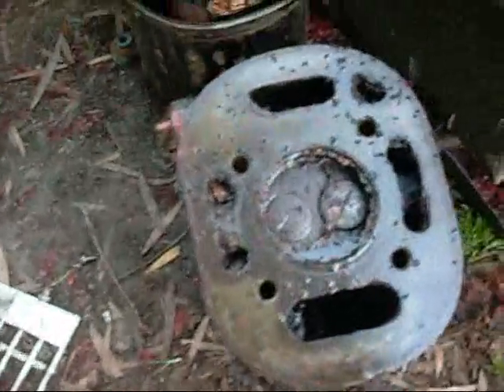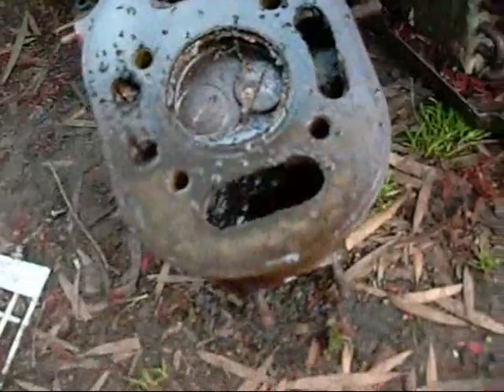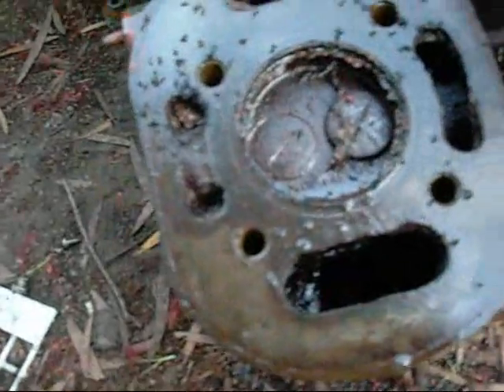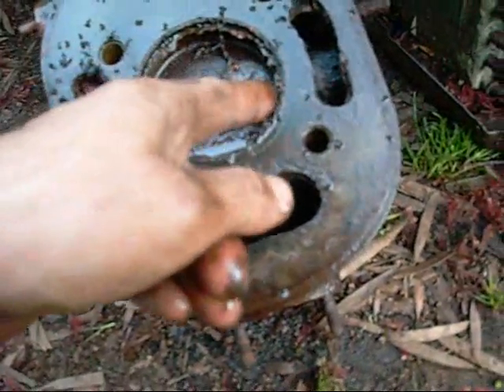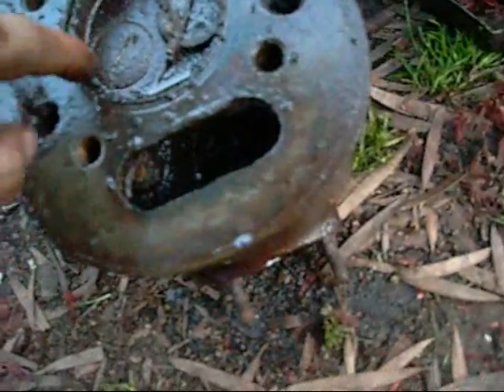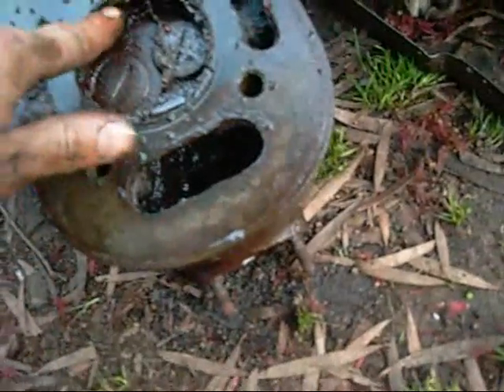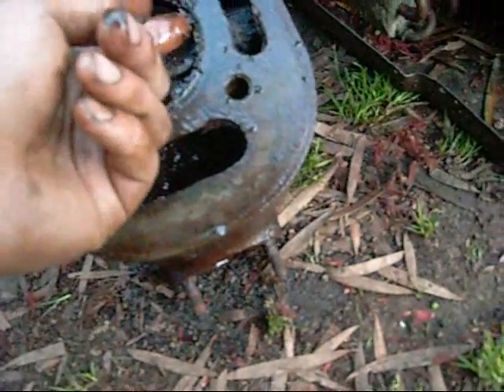I took the head outside because I disturbed the remaining ant nest — there's one up in the back of the passages that I couldn't clean out with the gurney. The valves are open — that's the exhaust. Explains why so much water got into it. But the good thing is there's only rust damage up here. There's a spark plug hole — they poured oil into it and let it go gooey, and I think it saved it. You can see where the water level was though.